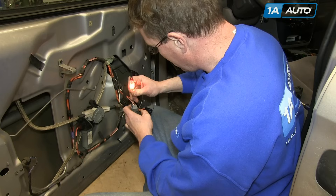If you were not able to find that you have power to the switch, then you would need to look for either a break in the wire between the body and the door. Usually if you pull the little boot back that protects the wires that run between the body and the door, you'll find a break in the wire. The other thing is you could have a blown fuse. But you've ruled out step one — you've got power to the switch, so power is getting to the door.